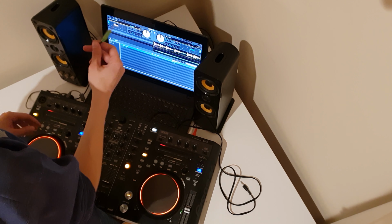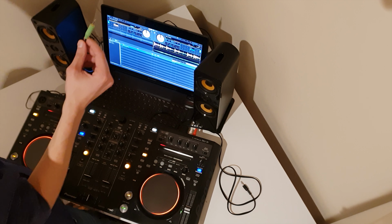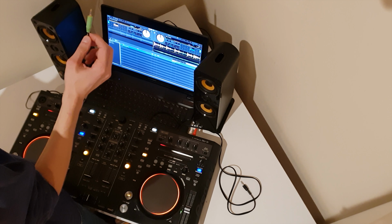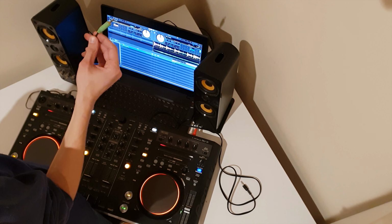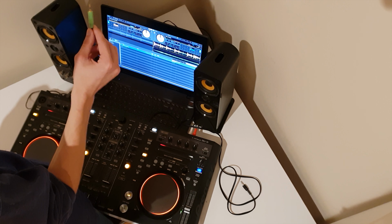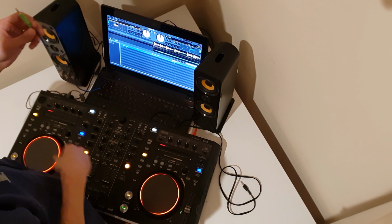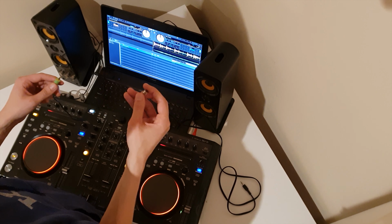Now, you're probably going to notice this. This is the cable that comes out through the back of the speakers, so this would be your audio cable. It's got a green jacket on the outside. You've probably seen this kind of jack coming from a pair of headphones, which normally has a microphone. The microphone would be in pink, and this is green. Green is for the audio for your speakers or your headphones, and the pink one would be for the microphone. So what we're going to do is get the 3.5mm jack and connect it on.